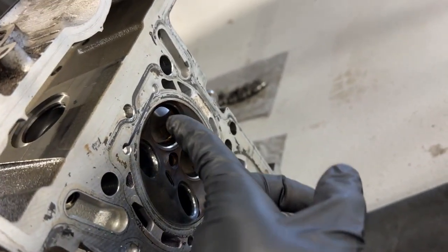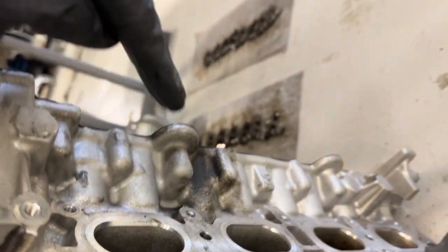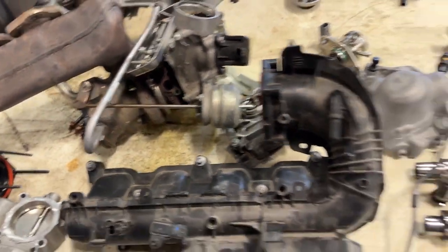It actually leaked right back through the valve, right out of the intake port, back to the throttle body, and out of the air filter housing. So that little smoke machine helped us diagnose a cylinder head for a mixture adaptation code. It kind of saved the day, because you can hear air by doing a leak down.